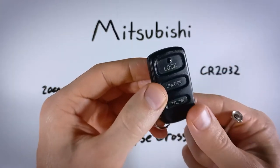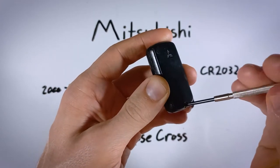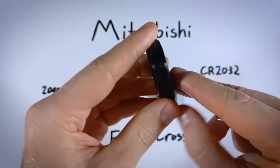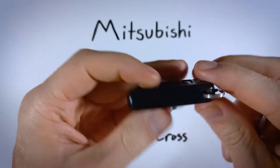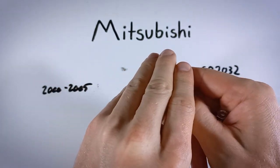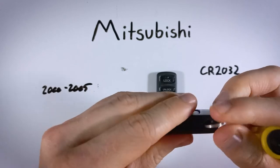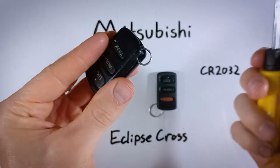Opening the device is very easy. We will start by removing the screw in the back — go ahead and pull that out and set it to the side. From here, you can just try to work it open with your fingers, especially coming in at the corner for a better pull. You could also take a flathead screwdriver if it's feeling stuck and go into this corner and just give it a little twist until it comes open.